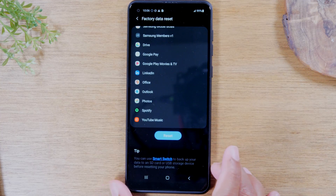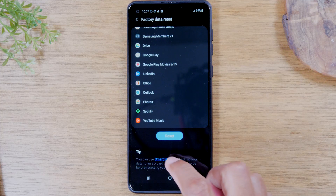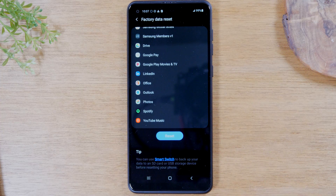It's going to set the phone up like a brand new phone. One important note — if you have data on this phone that you would like to save, you should hold off on doing the reset. At the bottom, it shows you that you can use the Smart Switch app to transfer your data either to a memory card, to a USB storage, or to transfer it to another phone first before resetting. Because once you reset, you will not be able to get any of that data — pictures, contacts — all of that will be erased if you don't transfer it first. Tap on Smart Switch if you'd like to transfer any of your data. We have a link below in the description of where you can buy a memory card, or you can download the Samsung Smart Switch app on your new phone to transfer your information before you do the reset.